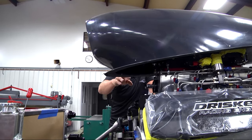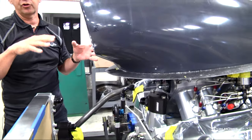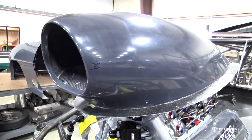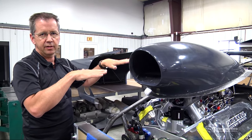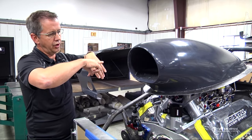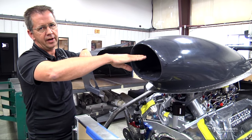This flange has been changed — it's not the flange that came on the scoop. This scoop in its stock shape sat a little too high because this is a 632, so it's not a real tall deck, not a lot sticking out of the hood. We wanted to push this scoop down as far as we could to give our driver as much visibility as possible. So we cut the bottom of that scoop off and fit it down flush to the hood, fitting it to the profile of the hood on top of that cutout. We used a Sharpie marker to mark around there and fit it down flush on the hood, giving us good area above the carburetors for an air inlet.